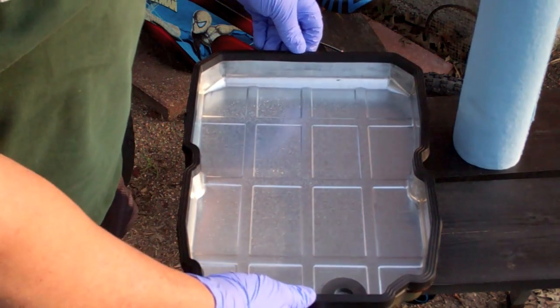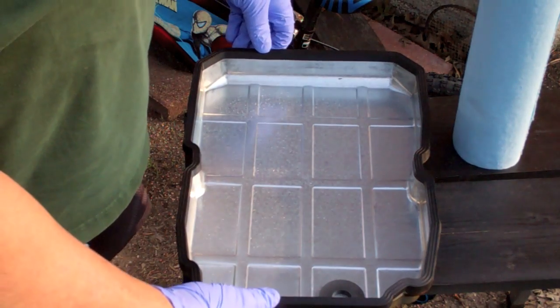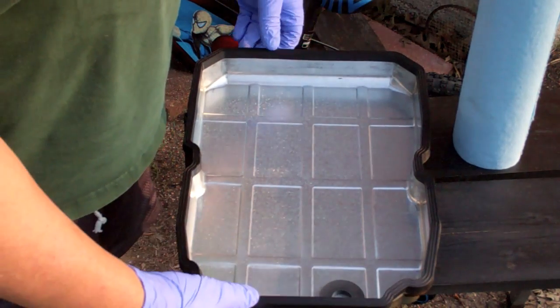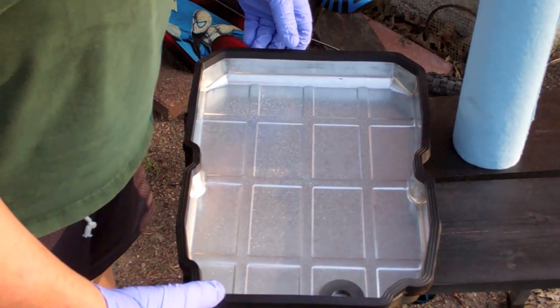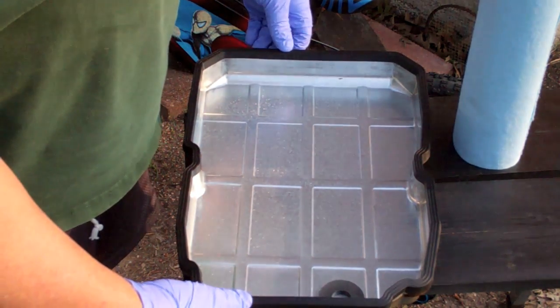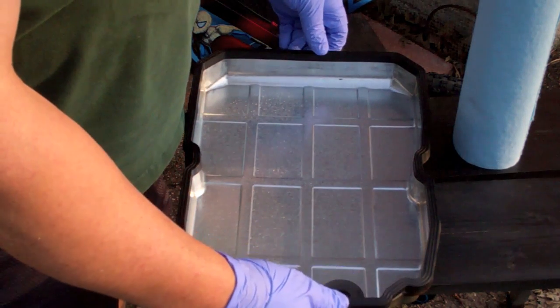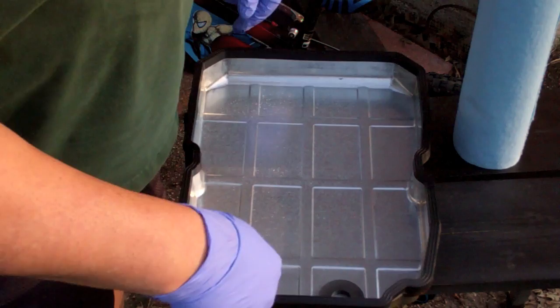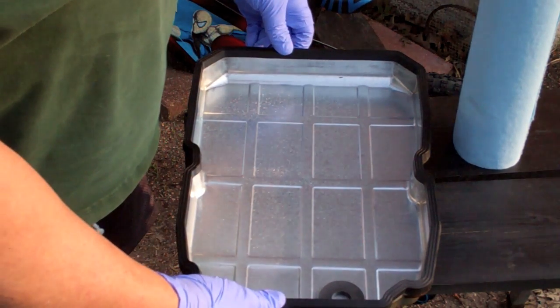So now I'm going to put this back under the car, bolt it on. It calls for 70 inch-pounds of torque on the bolts. Unfortunately, since it's a T30 size, I don't have a tool that I can put on a torque wrench to do that, so I'm going to have to hand tighten this to the best of my ability equally, roughly 6 foot-pounds or 70 inch-pounds.